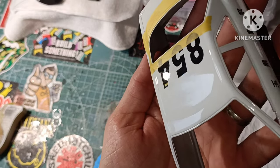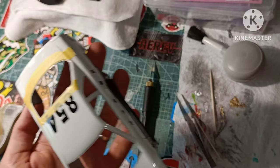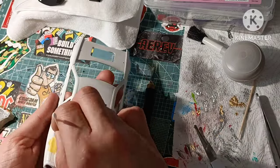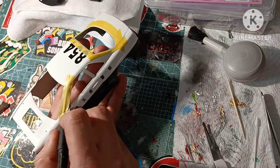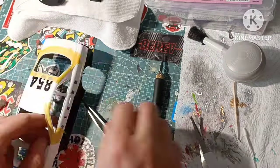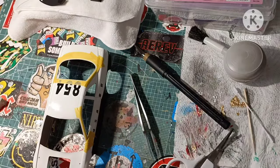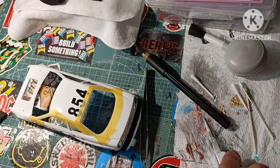As you can see there, I've actually decided against polishing this because the reflection and gloss from the Street Blisters 2k was good enough as it was. I've only got 2500 grade wet sand and for this 2k I definitely needed a few higher grades. I tried polishing out the bonnet with 2500 and it was just leaving tiny scratches, so OCD was kicking in and I thought, you know what, I'm just gonna leave it as it is. Even with a couple of specks of dust here and there, in the grand scheme of things I still think it looks incredibly glossy and I really like how it looks.